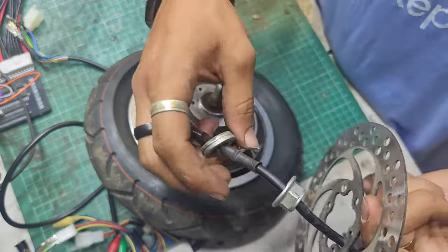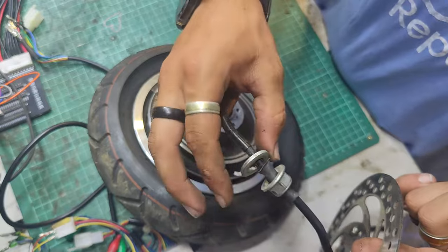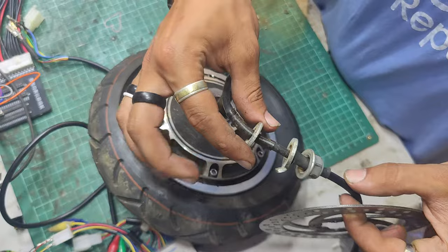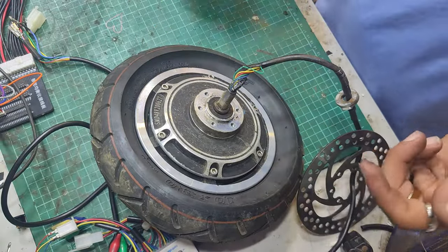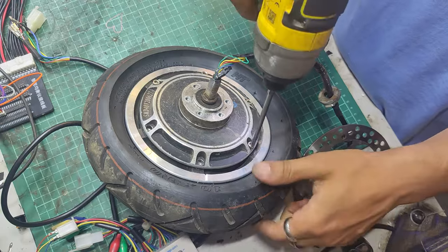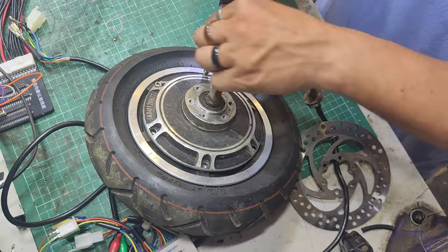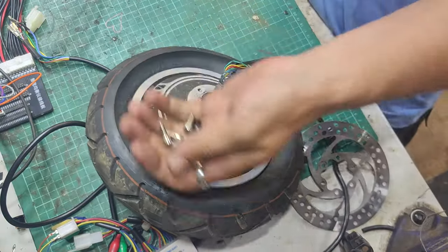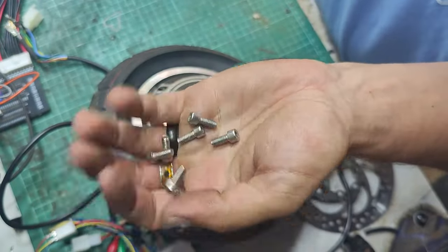On this particular one, I've got no idea how much messing's been done with it, but there's a large bog-standard nut there - I think it's 18mm. We've got our washer with a little tongue on it, and we've got another washer here. Then there are six more screws and they look to be 4mm Allen heads.